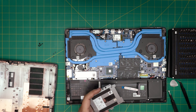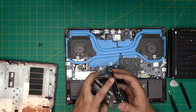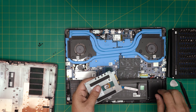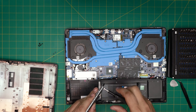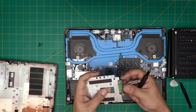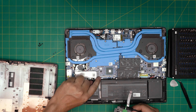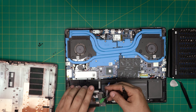If you want to add a mechanical drive or SSD here, it has to be low profile. All SSDs are low profile, but for a mechanical drive you can go up to two terabytes low profile. Place the drive so the screw holes match, attach it, then grab the adapter. This is an HDD connector — lift up the cover upward 90 degrees and push the adapter in with the little bend.